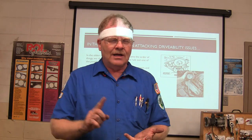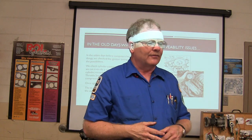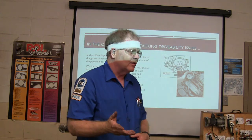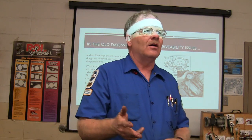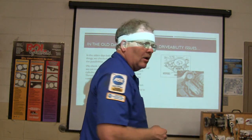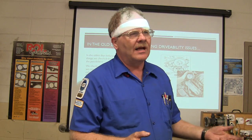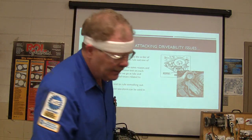If you've got a healthy bottom end — on this one he's working on, we've got this four-liter Jeep and the guy was talking about it making lifter noise. So we got a dial indicator, set it on top of the pushrods, and turned it through. It's supposed to have 253 thousandths of lift on each valve, and it was up with 90 thousandths on a couple, 150 on one, 200 thousandths on some, and there's only one that's anywhere close to where it's supposed to be. So he basically gathered information without spending any money, and I called the guy and said you need a camshaft, lifters, and all the gaskets — because you can't put a camshaft in one of those without pulling it out, especially if you're going to replace the cam bearings. You've got to have the motor on a stand.